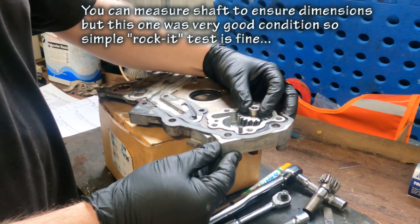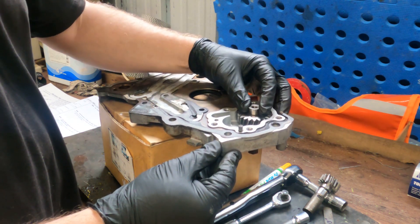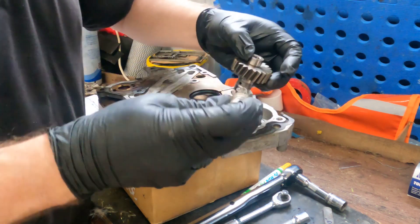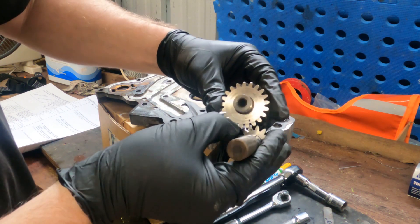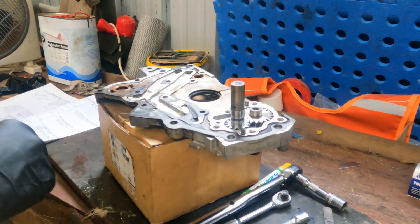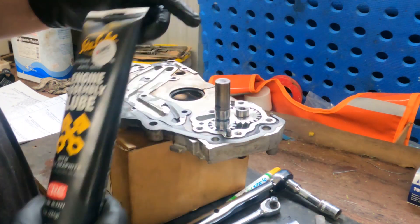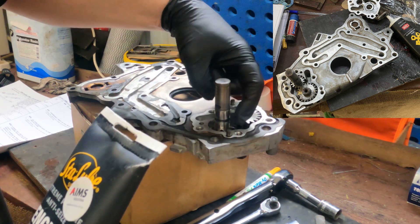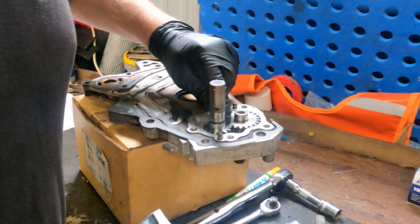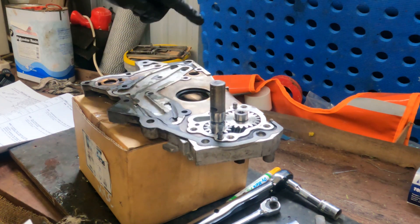Checking the wear of the shaft — you can probably see a slight rocking, which indicates a little bit of wear, but the clearance is still acceptable. Bear in mind when putting these together there are two alignment marks — make sure those are in place. I'll also be lubricating these gears with engine assembly paste, just to make sure all surfaces have some grease on first startup before the oil comes up, because the oil is only being picked up through this tiny gap in the gears spinning at thousands of RPM — so lubrication beforehand is imperative.